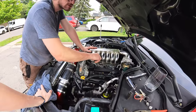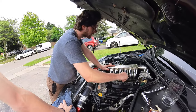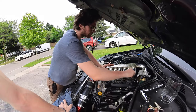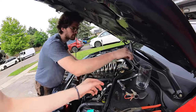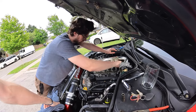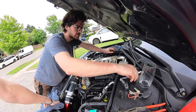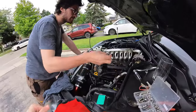And start all of these. You know they're 8 mil ratchet? A wrench? No, don't worry. I'm gonna go grab another nut. Just use this one. No, I need another nut for this one. Because when you tighten a stud, you don't want to tighten on that nut, because that nut might just go loose. So you're gonna want to double it.